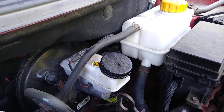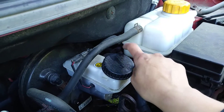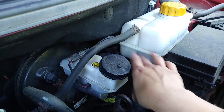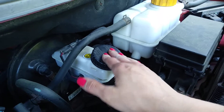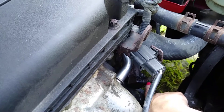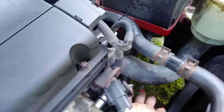I'm gonna do a little clutch work on my car today and want to show you how the system works. Through the firewall, your clutch pedal pushes a rod outward, which gets fluid from this reservoir — on this car it actually takes fluid from the brake reservoir. The lines then run across the firewall and down into the slave cylinder.